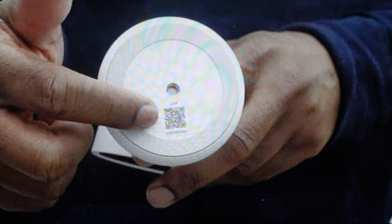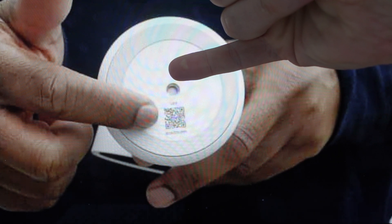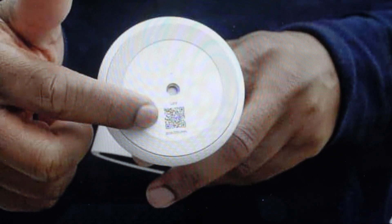Once we do that, we're just going to come to the bottom of the camera and find the reset button which is right here. You're going to press and hold that reset button, and then the light ring will start to spin blue on the camera. You can release the button once it's spinning blue. Then the camera's lights will turn off while it's resetting, and you'll know that the reset is complete when the camera makes a chime and the light ring starts to slowly pulse blue.